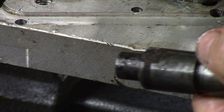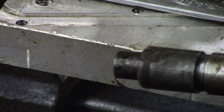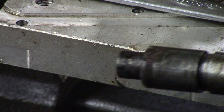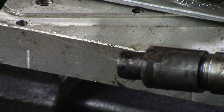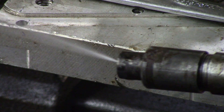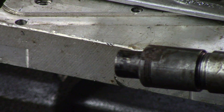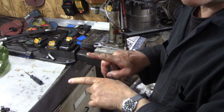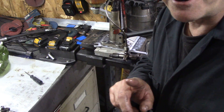The spring pressures were right, the burst pressure is right, but the jet was wrong. 100... 120... coming up — look — see, that's why your diesel smokes and that's why they won't start. Do some pumps and you can see the nozzle on this one, because these nozzles have a two-stage jet: one that fires this way, one fires this way.